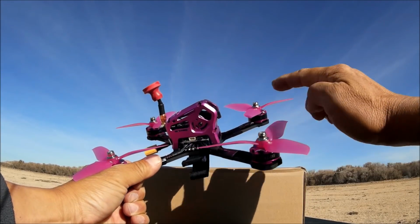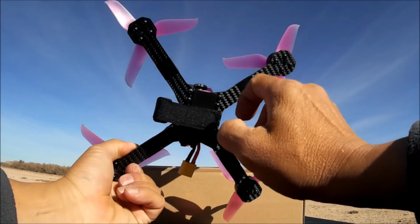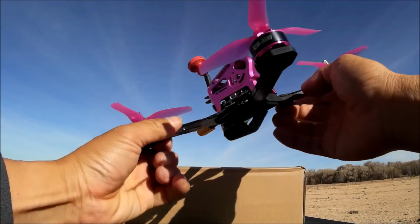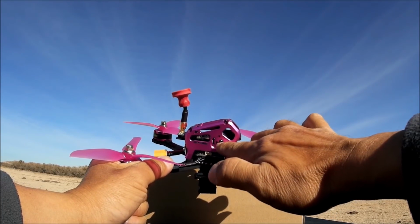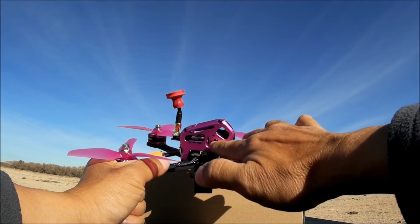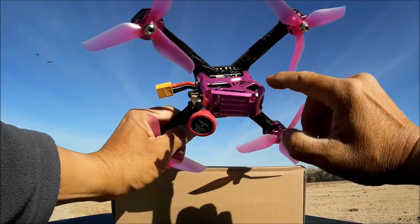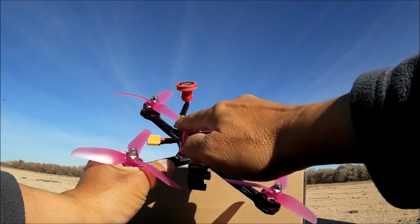3 screws on the housing to separate it, as well as you needed to undo 4 screws on the bottom of the quadcopter to lift the housing up so you can undo it, as well as remove one of those screws so that the camera can be separated as well in order to get into the receiver and the VTX.